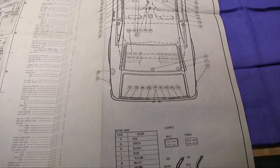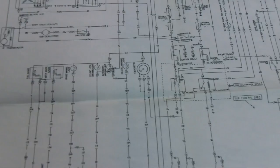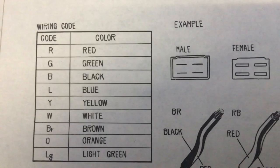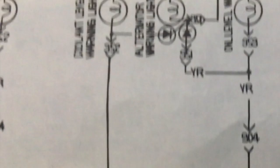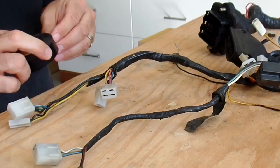Now I've got a full-size wiring diagram for the 76 Mazda RX-3 — somebody on eBay was blowing it out. Now I can read it. The one in the Mazda manual is really tough to read and the Haynes is even worse. Nice big diagrams, easy-to-read text, explanations for each little plug everywhere on the car. Going to the legend: capital B capital R is black-red, and B small r is brown. After pouring over the chart, I can see that B small r brown goes to the coolant level sensor — that's the little sensor inside the overflow tank. My new overflow tank doesn't have that sensor, so I need to figure out how to incorporate it because I want the coolant level warning light to work.